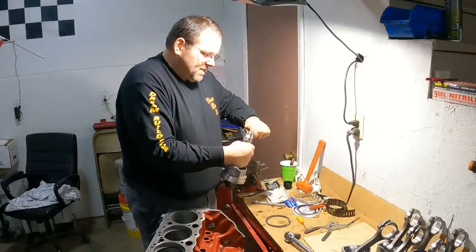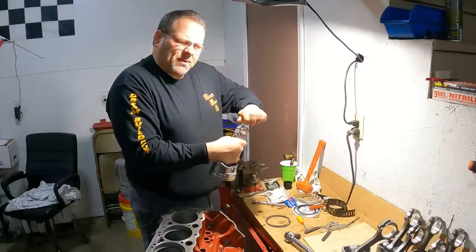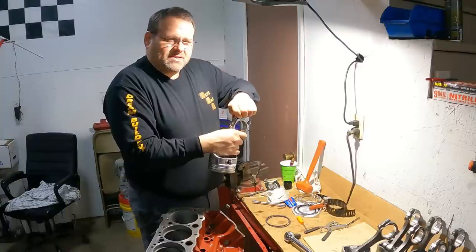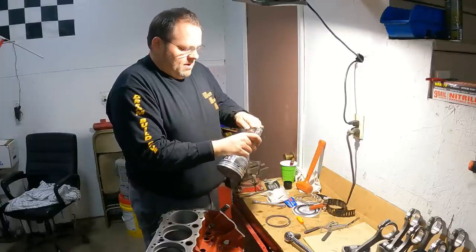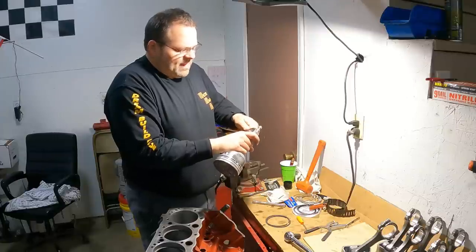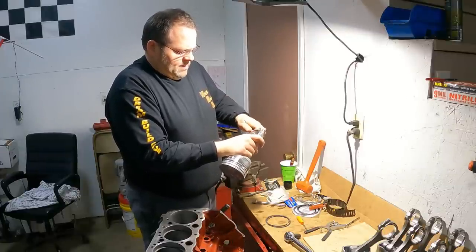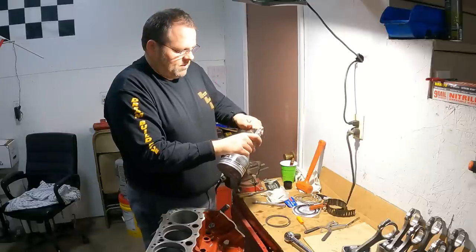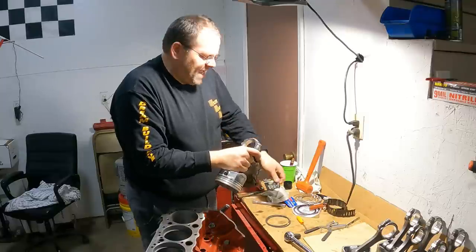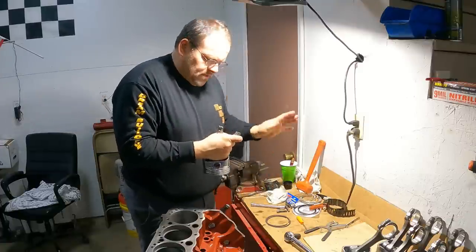Of course, our bearings are already sized up. The biggest one I had came up 3.3 thousandths. Most all of them were right at 3/1000 clearance. One was 2.9. So I'm not worried about sizing them to the individual locations or anything like that. We're fine, we're gonna run it. And that was rod bearing clearance I was talking about, so it was right at it, but it worked out just the same. It's the same amount of wear on the crank on both of them, so it worked fine.